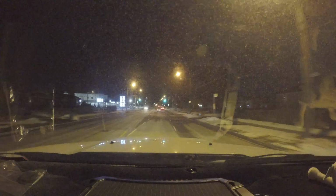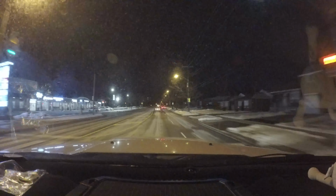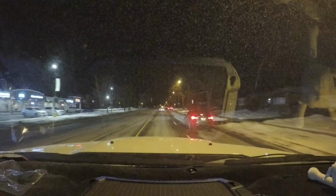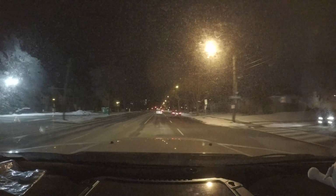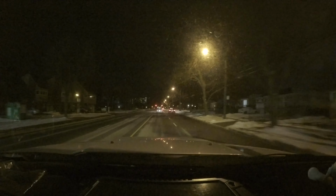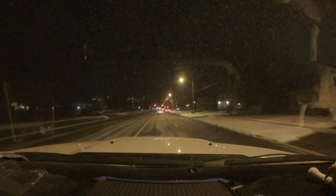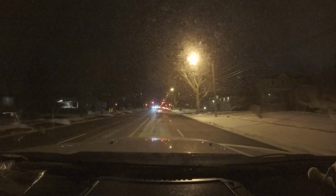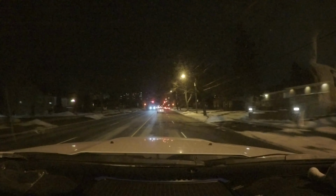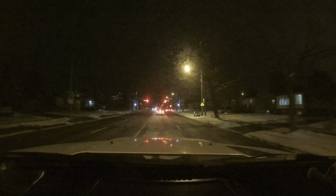So for example, let's say you're driving in very deep slushy snow for extended periods of time, your foot is into it, and you are asking a lot of that transfer case. You can overheat that, you can cause it to slip, and in that case, the 4-wheel drive lock feature in that transfer case is not quite the same as in this base model transfer case, because in this one, when you put it into 4-wheel drive lock, it is basically locking a mechanical connection to the front axle.